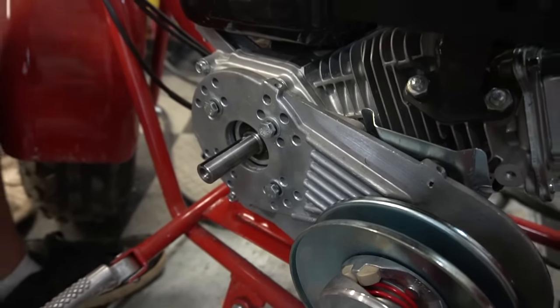So our torque converter backplate and rear pulley are bolted onto the engine, and at this point we need to point out an important difference between newer CT200s and older ones. This is an older model and it uses an engine with a 3/4 inch output shaft. If you have an older one like ours with a 3/4 inch output shaft, you're going to need to order a different torque converter and the engine spacers separately. So there are links to those in the description too.